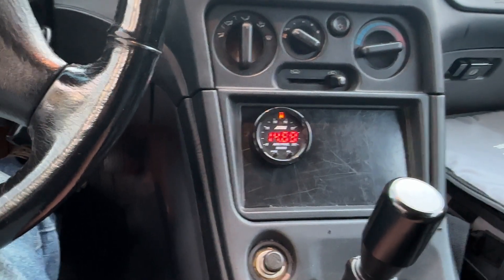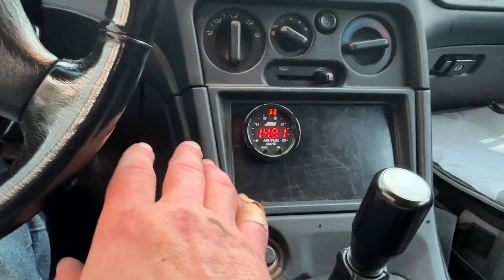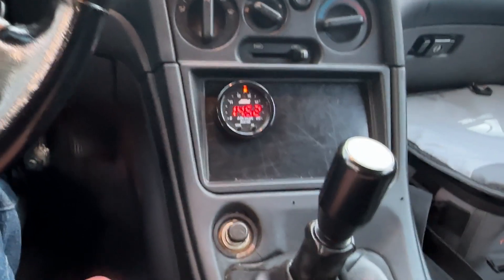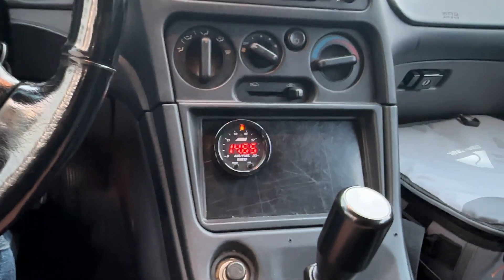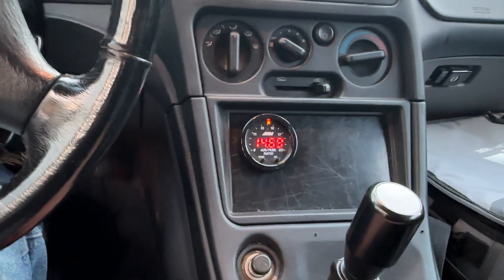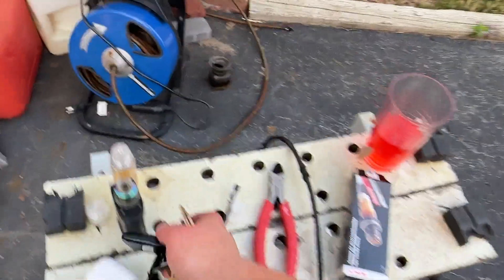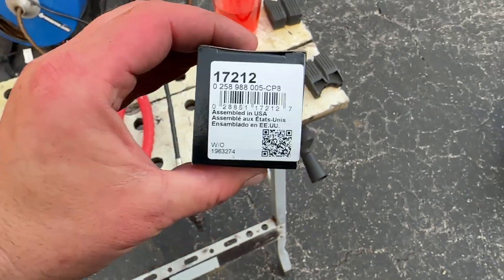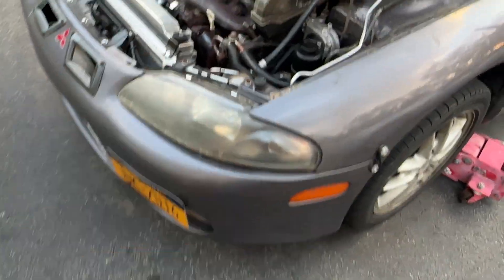I think we're going to call this a win. I'll post in the comments tomorrow whether or not this fixed it after I take it on the highway. I stayed off boost for the last couple of days because I didn't want to hurt anything, but right now these numbers look exactly like they did when I first got my tune dialed in. 70 bucks compared to like 183 for the OEM replacement sensor — it's a good deal. We can say with some certainty that the AutoZone Bosch LSU 4.9 sensor, part number 17212, will work with your AEM Series X wideband.